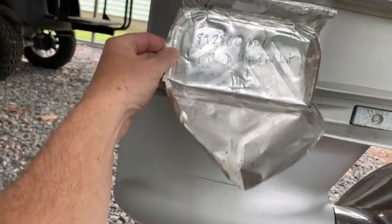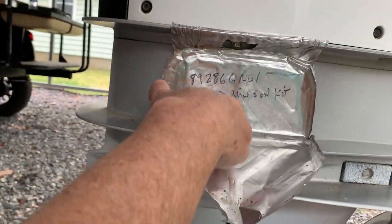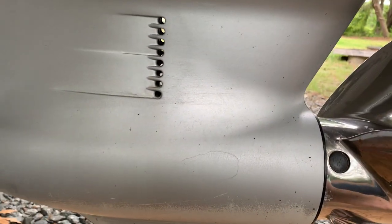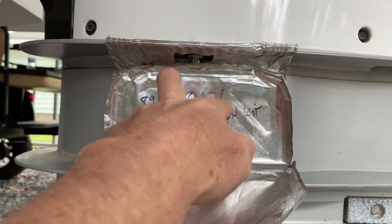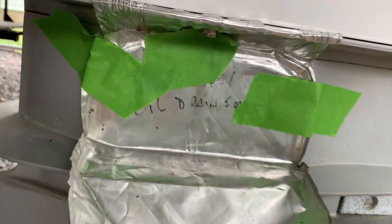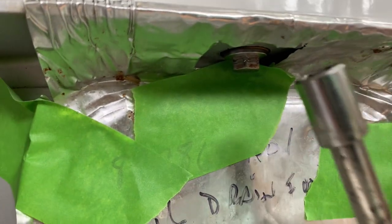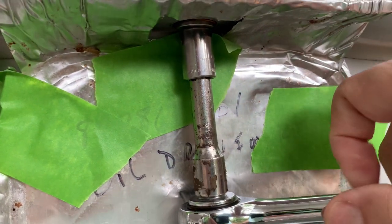Time for my special Quicksilver drip pan — it just goes right in like this, and I can get up under there to the bolt. The oil will come down here and run down into my bucket without getting into the water intake or getting all over the out drive. Nothing too fancy, but it works. I've got a little bit of painter's tape on there. The wind is horrendous out here — sorry about the noise. Now that it's in place, you just want to put your ratchet on here and loosen up the bolt.